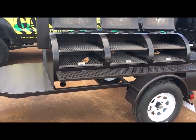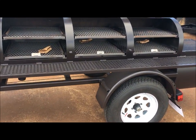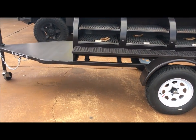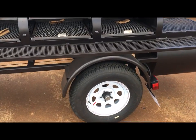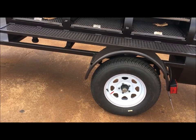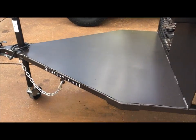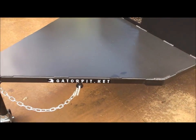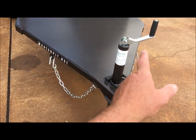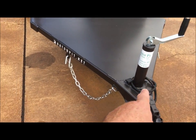Easy to adjust them. The trailer frame is quarter by 2x2 tubing, square tubing. It sits on a 3,500 pound Dexter axle. We've got 5 lugs, 15 inch white wheels with 205/75/15 tires. And the front deck is solid plate. We've got a 2-inch coupler, jack wheel on this trailer, showing a jack wheel, removable, your screw jack,